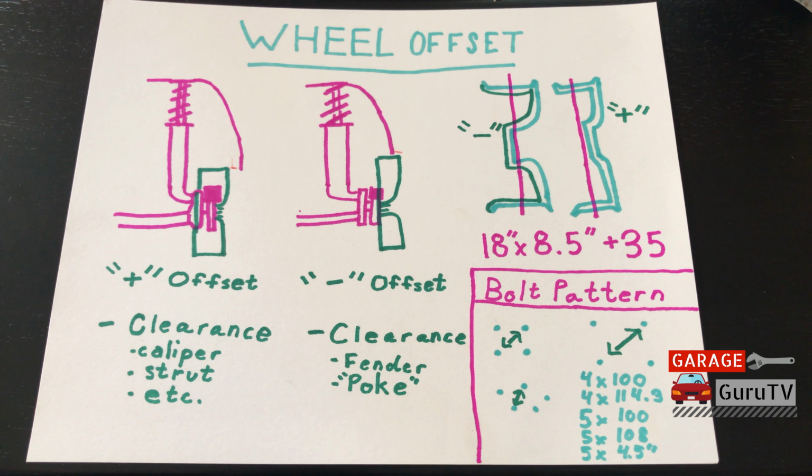The importance of tire fitment is as important, if not more, than wheel fitment, since tires are your only connection to the road. Tires are covered in letters, numbers, and symbols that can look confusing at first glance, so let me walk you through the markings. The first letter indicates the type of vehicle the tire is rated for. In this case, the P means this is a passenger tire. The other common rating seen here is ST for trailer tires.